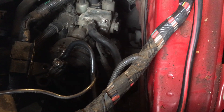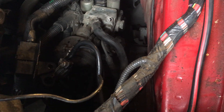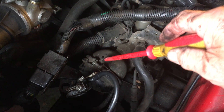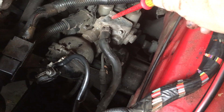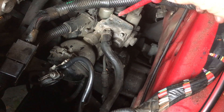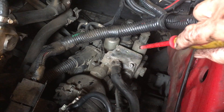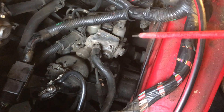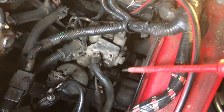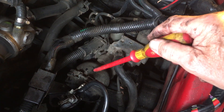The system operates as a normal pumping system. It has a pressure switch — when the motor is turned on it pumps into the accumulator tank down here and pressurizes the system. The electronics detect when you're selecting a gear and operate one of the solenoids to put it in gear. That's where you bleed it from to start.